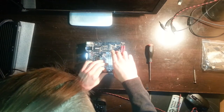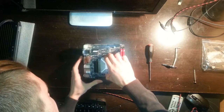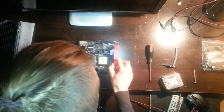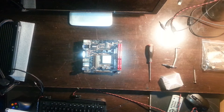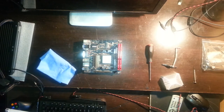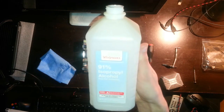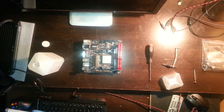First you move this to unlock it, then try not to drop the motherboard like I did. Here we can see the CPU now because the cooler is off. Now you get something like 91% isopropyl alcohol — something with a high percentage of alcohol — because it's easy to clean the CPU with it. You have to clean it off before you put a new cooler on, so all the thermal paste comes off.